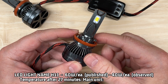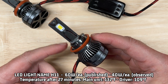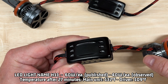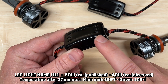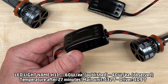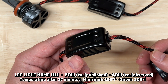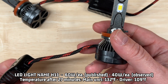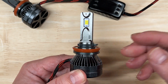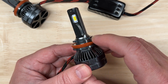There is a published rating of 60 watts per light, but I only observed 40, so I think that 60 watts might be a misprint. For heat management, after 27 minutes, my laser thermometer recorded an average of 132 degrees Fahrenheit on the main unit. However, the driver is an anomaly — I measured it at 109 degrees Fahrenheit, the lowest I've measured for an external driver version in my testing so far. This is impressive because the Bevensey V45, the brightest light I've tested, measured 138 degrees on the main unit and a very hot 172 degrees on the driver. This driver does a very good job at keeping the main unit really bright while keeping the heat at a minimum. I did notice it fit slightly loose in my test housing, so if your housing doesn't let the bulb seat snugly, you might need to source a different gasket — perhaps the factory halogen gasket will fit.